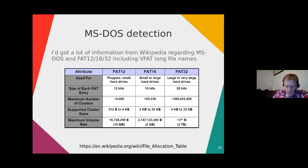I've also moved on to MS-DOS detection because I happen to have loads of MS-DOS disks — both 5.25-inch and 3.5-inch. I was able to image both using the BBC drive I had as well as a PC 3.5-inch drive. I found the Wikipedia page on the file allocation table description very detailed for reading data and working out disk formats. I've got support for FAT12, FAT16, and FAT32, including long file names, deleted files, dates, and times — all printed out in the catalog.